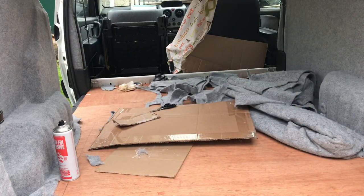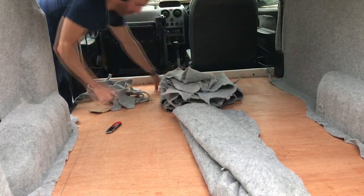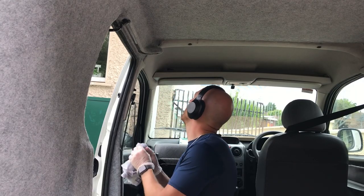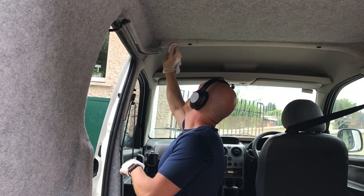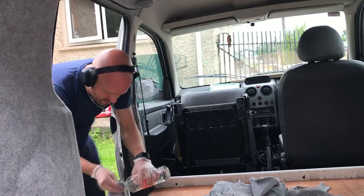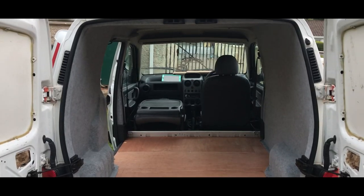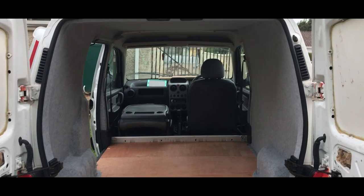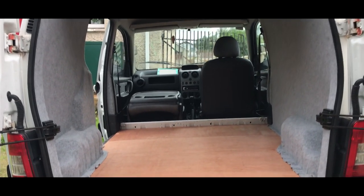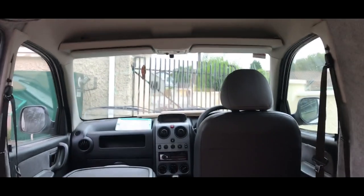Just tidying everything up here now. Going to use some white spirits, which will take off any little bits of overspray that might have got around the vehicle - there's a little bit on the headlining and a little bit on the door sill. If you do get any overspray it will come off with white spirits. One thing to note: don't use blue paper because the colour can transfer onto the carpet - use a clear cloth, something with no colour in it. And this is the finished product, guys. Thanks for watching. Tune in to the next one - we've got to finish off the bed, finish off the sink cabinet, and maybe even get them all painted.